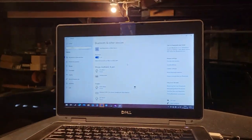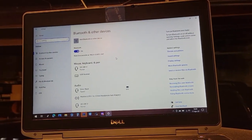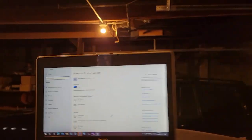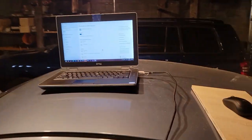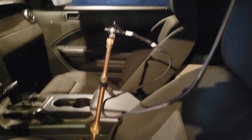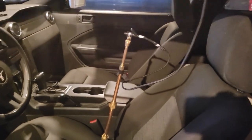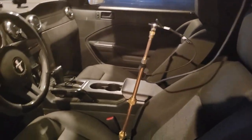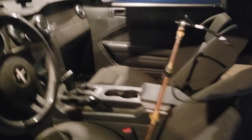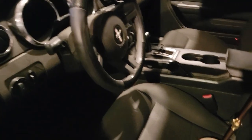Come over here, get set up so y'all can see what I'm doing. I have my laptop right there hooked up to my Dayton IMM-6. I'm gonna check and make sure I got my cal file loaded up in REW so I can get a good signal. From there, that's gonna be reading the pink noise that I play out of all my speakers.